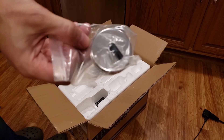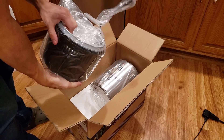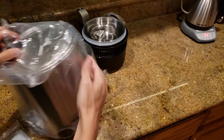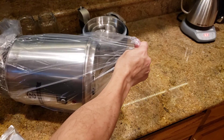There's a lid for the collection container. Now for the unit itself — this top part is the condenser, which causes the water vapor coming from the machine to turn into a liquid again. The bottom part is the boiler, which boils off the water turning it into vapor that goes into the condenser.